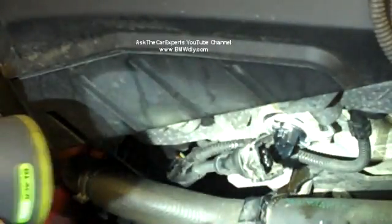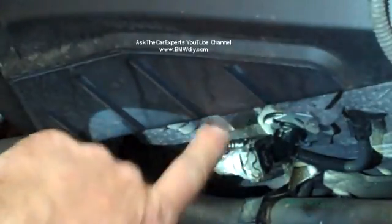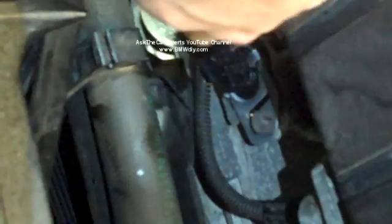The intake one's harder to see because it's up under here. But same idea, I'm going to slide that in next. And remember my exhaust wire's up here, and I want to remember to route it. You can see that that's still behind. Alright, there's my solenoid. There's the 10mm bolt, and my wiring is behind the solenoid.